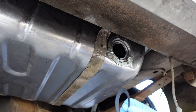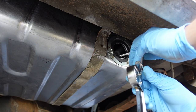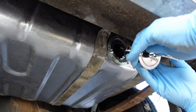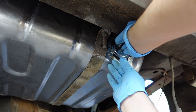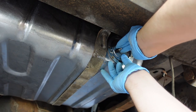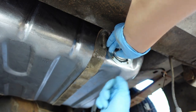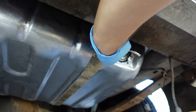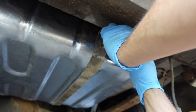I'm going to go ahead and finish putting the sending unit in since I know that the sending unit itself is not the issue. You don't want to forget the gasket. There are little notches that the sending unit fits into, so it'll only go in one way — and that's it right there. A lot of times I'll kind of help the gasket into position using a screwdriver. This one came with a new lock ring.